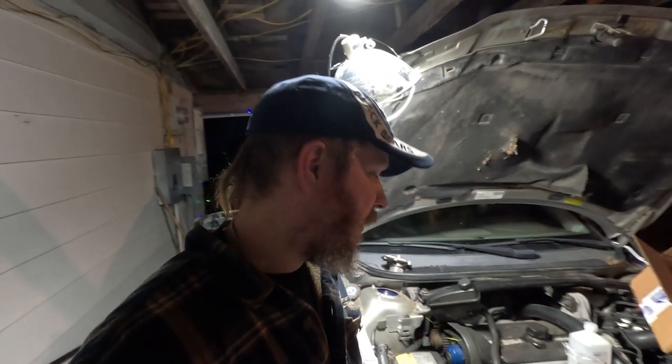We'll get in there and show you what you want to do, which is just torque it down, but do it in kind of a cross pattern just to make sure that everything gets torqued down evenly. And then this water pump will be installed. We can go ahead and start reassembling stuff tomorrow after we get home from the day job and get those camber bolts installed. That'll be the next step. So for now, we're going to go ahead and torque down this water pump, get everything buttoned up on this side.